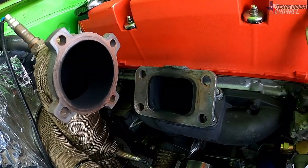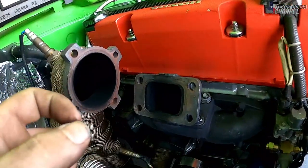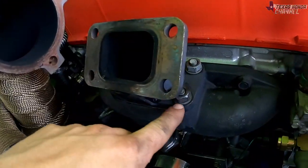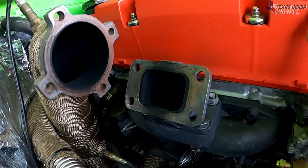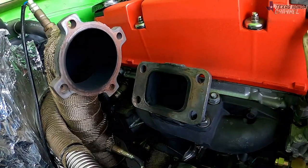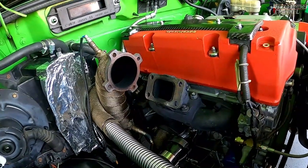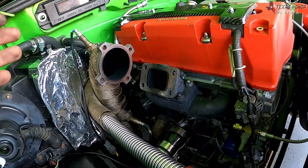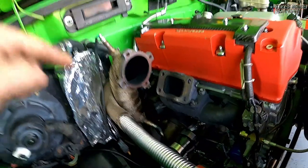One thing to make sure to do is go through and retighten your bolts or use some lock washers, because that helps tremendously. Like, I have lock washers on these and they're not loose. So just keep that in mind. It can cause spool issues. A lot of malfunctions that most people have with turbo is from user error, not always MaXpeedingRods turbos that are bad.